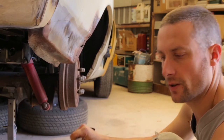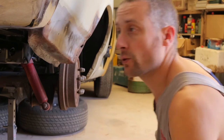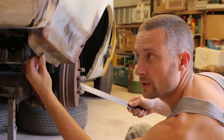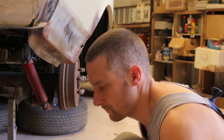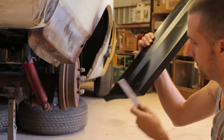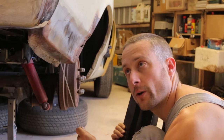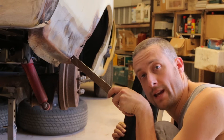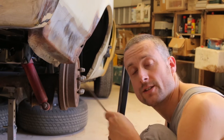I was comparing my left-hand side reproduction patch to the good factory steel here. The quarter panel comes down, turns in horizontal, and there's a lip where it joins to the inside panel — at its broadest, just under two inches. Now on my patch, where it turns in, at its broadest it's not even one inch. So they don't sell you this steel when you buy a reproduction patch. I'm pretty disappointed I don't have this steel on my patch.